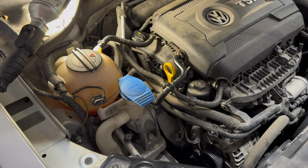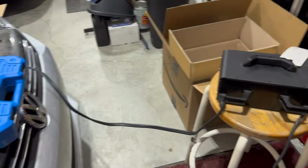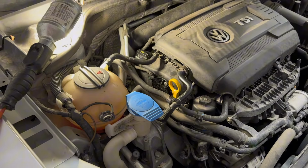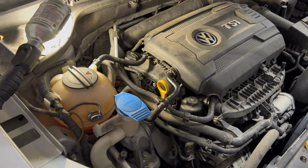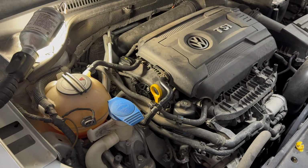The following day. Well, guys, since everything's back in place, I have rescanned the vehicle with the OBD11 again, and this time our P0341 error code is gone, but now we're getting a P0011, which is this time the timing is kind of advanced or way off on the cam.